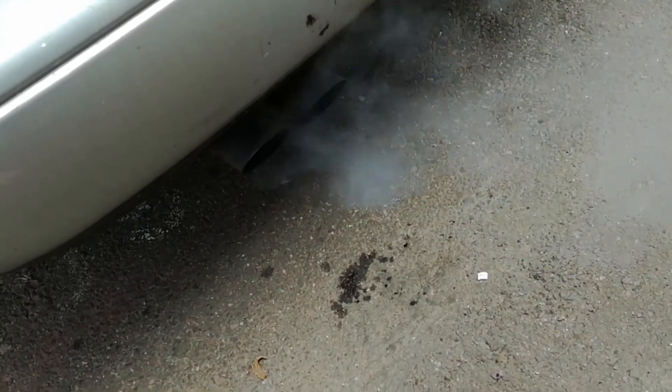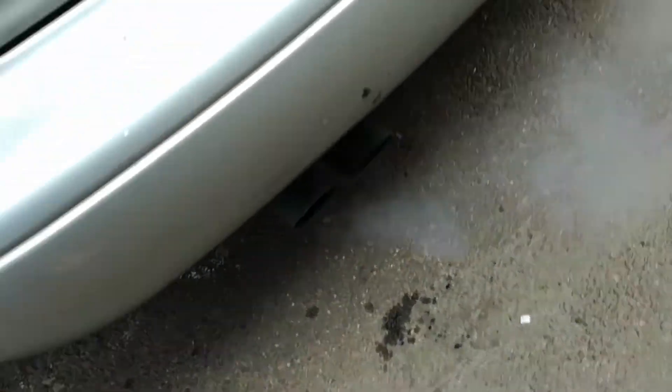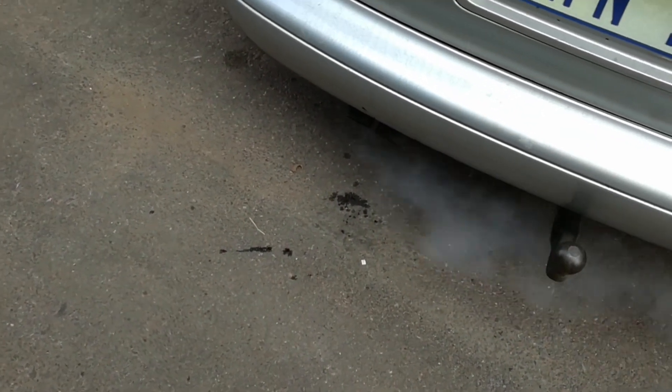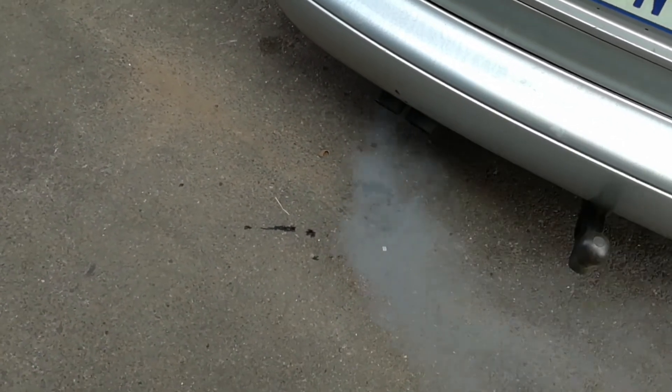Make sure that you take it for a drive after you're done, and don't forget to block up the breathers that come into the air system, otherwise you could end up contaminating your oil with the steam. Anyway, hope that helps.